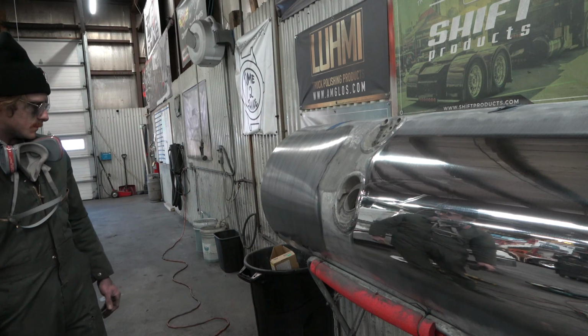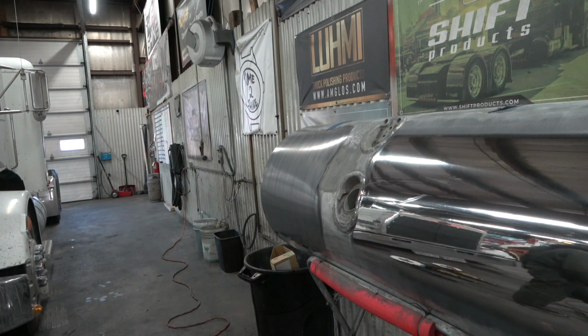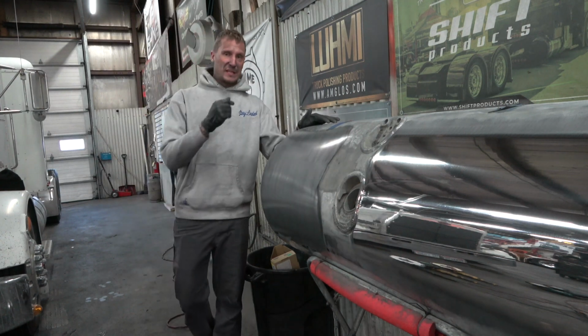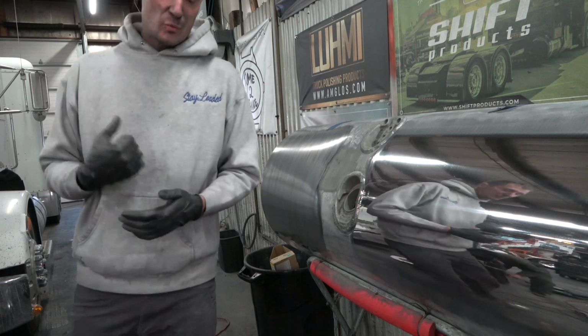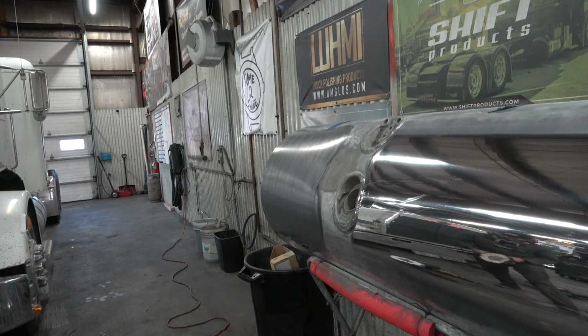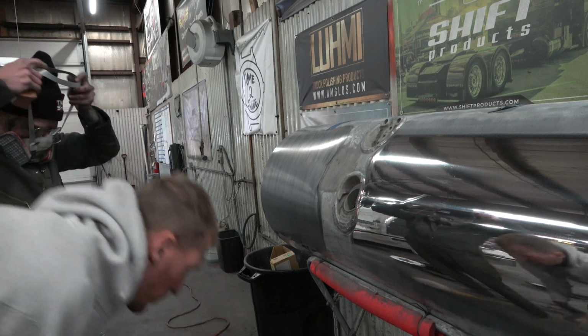But anytime you're using a new buff, always check it, especially in these softer grits, to see if it needs raking. If it doesn't need raking, don't rake it, unless you're on your white and purple and it's scratchy. If it doesn't feel scratchy, don't rake it at all. I tell everybody, you don't have to rake it if you haven't over compounded it. White and show brown feels good? Yeah. Sweet. Show the camera this one. Yep. We'll get rid of the regular brown.